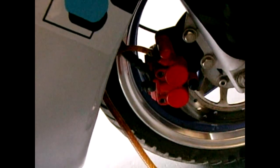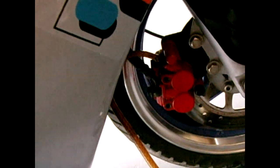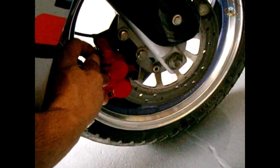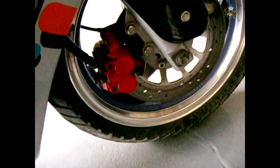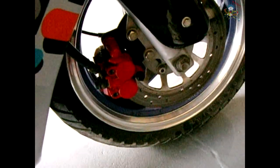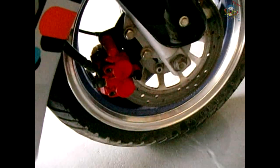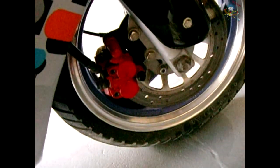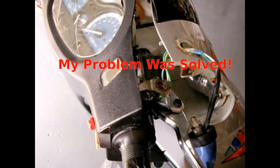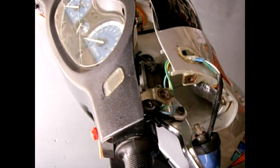After you do that, top off the reservoir to about a quarter of an inch from the top and then secure the cover. Once you have completed the brake bleeding procedure and the bleed screw has been tightened back down, squeeze the lever a few times to make sure it's not squishy. When you squeeze the lever, it should become very firm. If it's still squishy, that would indicate there is air in your brake line or inside the piston assembly being compressed rather than pressurizing the brake fluid, so you'll have to repeat the brake bleeding procedure one more time. Thank you for watching this video — if you enjoyed it, please rate it a thumbs up, subscribe, and post links to this video on other websites and blogs. Be sure to check out my video playlists as well.